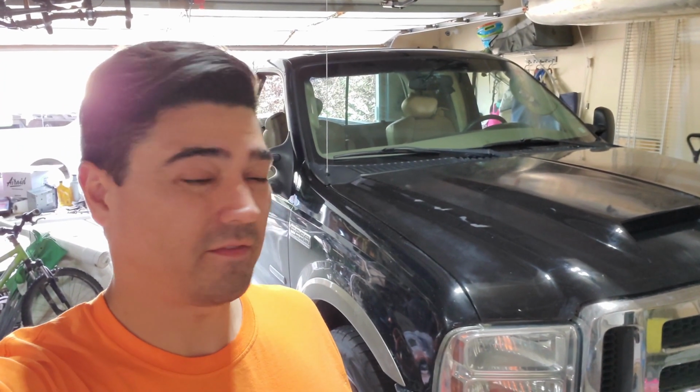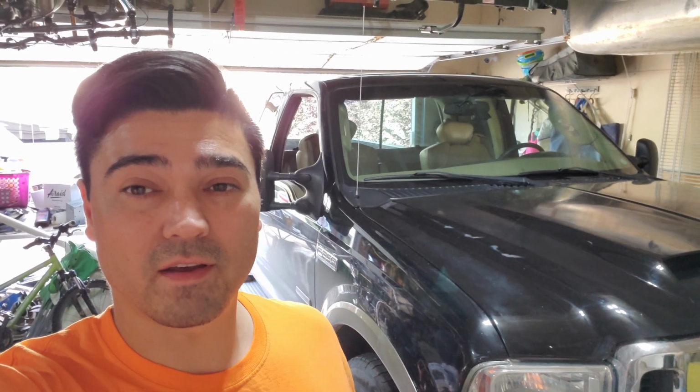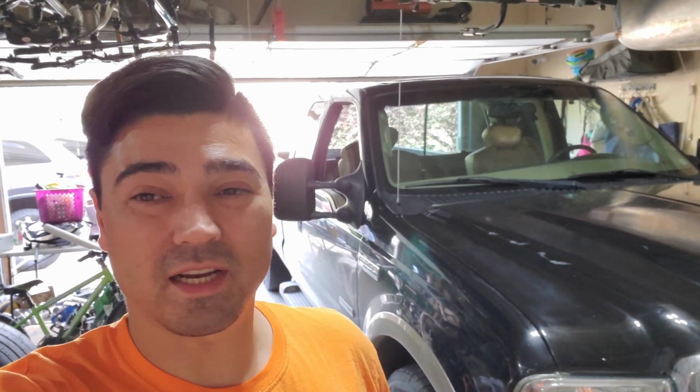Well, if there was a good day for a brake caliper to lock up, I guess it was today. The rear diff cover showed up and I was planning on getting that changed out and the rear diff fluid and addressing the emergency brakes. So I was already gonna be touching some of that stuff. It actually is the front passenger side caliper that locked up today while I was driving around. Had to stop and buy a pair of vice grips and just throw it on the brake hose so I could limp it home without it overheating and drive it home on one front brake and two back brakes. But it worked. I took side roads instead of the highway.